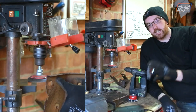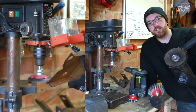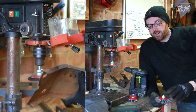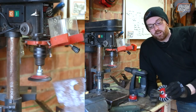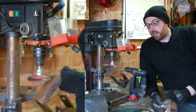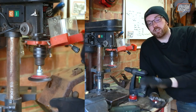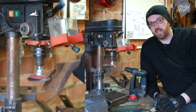What I've mounted in the drill here is actually an angle grinder wheel, but I choose not to use it in the angle grinder because I've had too many of these pieces launch off very early on in their use and I've had them embed in my leg about half an inch deep, which isn't really that pleasant. What I've done is put an M12 bolt through with a nut clamped down really tight, it fits well into the drill, and because it's running at a slower speed it doesn't launch the pieces of the wheel, the wire, or the dust anywhere near as hard. It's a lot better for the atmosphere, but you should always open the door when you're doing it, which is what I've done here.